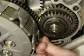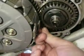I think it's actually called a generator. It requires this Motion Pro tool to pull it. One of the issues is that you can't get this nut off — Motion Pro makes a special tool for it, and I didn't have one. So I ended up having to pull the clutch side off so I could feed a penny in here just to jam up the transmission so I could snap that bolt free. You can see it ate the penny up pretty well. I don't know if I recommend it or not, but it did work.